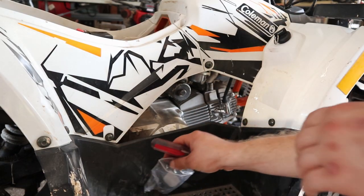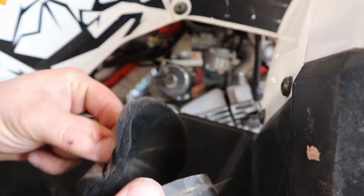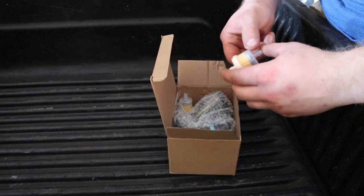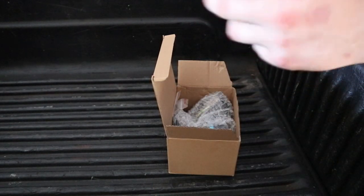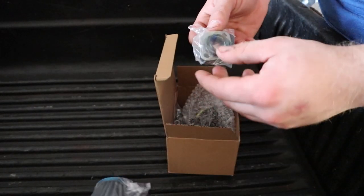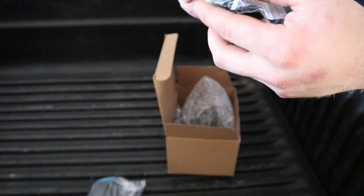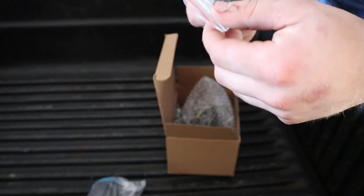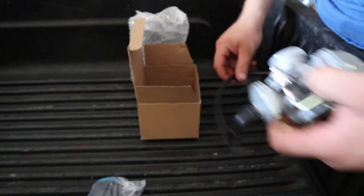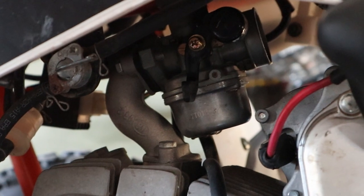Next thing to come off is going to be the air filter. It's literally just the same foam that keeps dust out — look at how thin that is. The carburetor kit comes with a fuel filter — two fuel filters actually, though they might be kind of cheap. The air filter looks good. It also comes with a normal gasket, two O-ring gaskets, two rubber gaskets with rubber O-rings, bolts to mount them, a fuel line, idle adjustment, and air-fuel mixture adjustment.